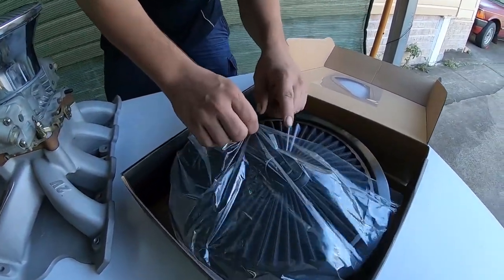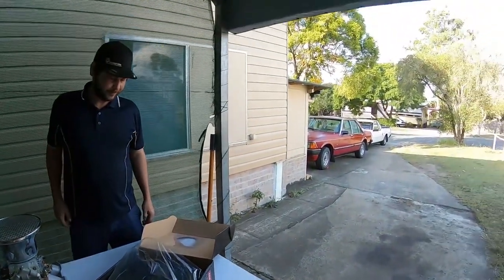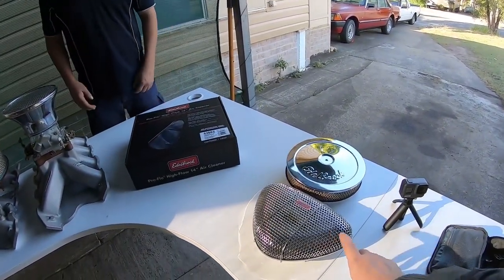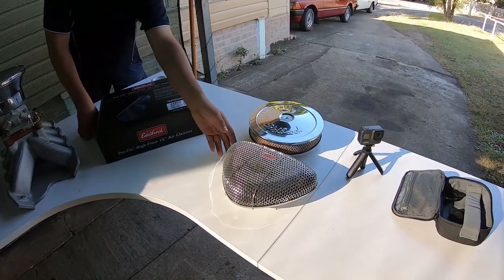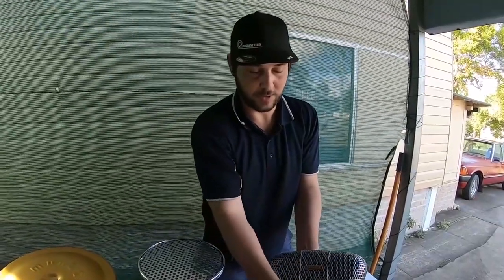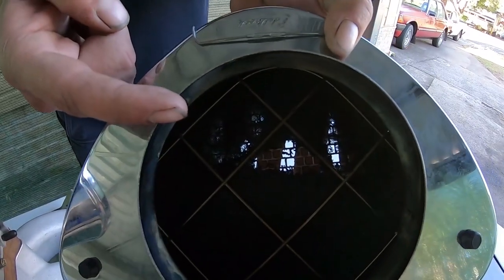I'm going to be doing one of my next videos with one of these on one of my street cars. Thanks for watching the video guys — there's a few little tips and tricks there. Now, these old foam filters — I had these out just to show you. A lot of guys like to fit these on very expensive cars that have bonnet clearance issues — Cobras, De Tomaso Panteras, all kinds of weird exotic cars. These have a really bad habit: when it backfires, they'll actually catch and burn.